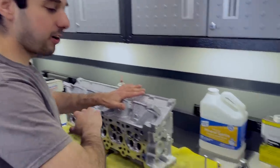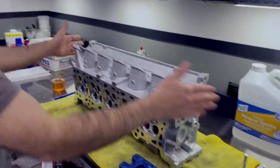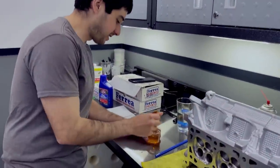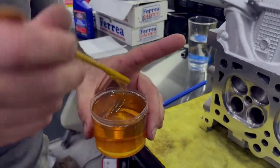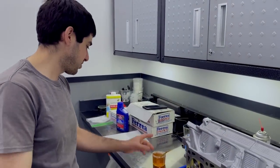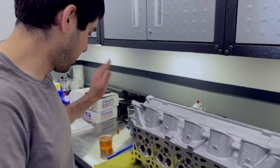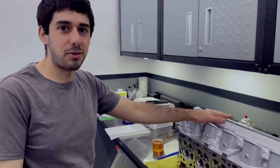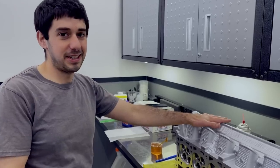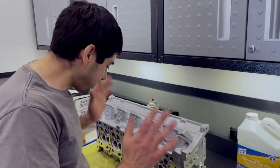It's finally time to put the heads together, hopefully for the last time. We got all the parts laid out and cleaned everything in mineral spirits. The heads are laid out and all the plugs are in for the oil passages, so this thing's ready to go. We got a little assembly mixture - half oil treatment and half engine oil 5W30 - which is what people use to put on the valves so on startup nothing seizes up. We'll be assembling everything together, and these won't be going on the block again until hopefully the last time for the leak down test.